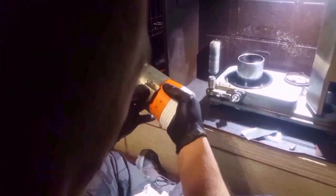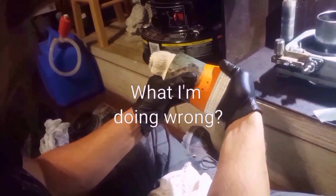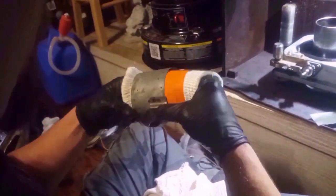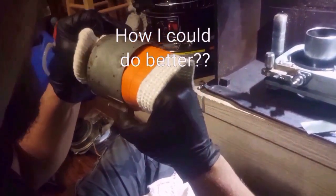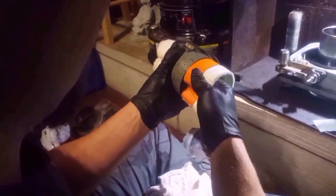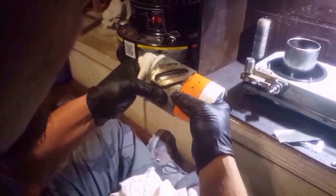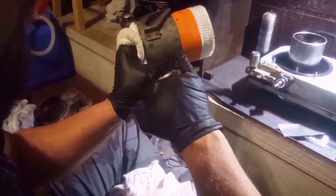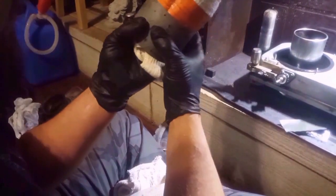Where my wick needs to be, from just past experiences, I'm going to go ahead and set it there. And then I'm going to put my hand inside here and we'll just work it around. I want it to be even all the way around though, so that way when it goes up and down, it goes up and down even and all together. Now this can be kind of tricky, so you just have to be patient. Basically put both your hands in there and just start snapping the wick into it, the little spikes, and then just work your way around. Make lines even all the way around.